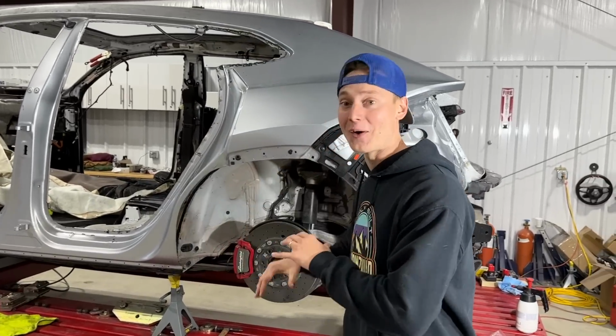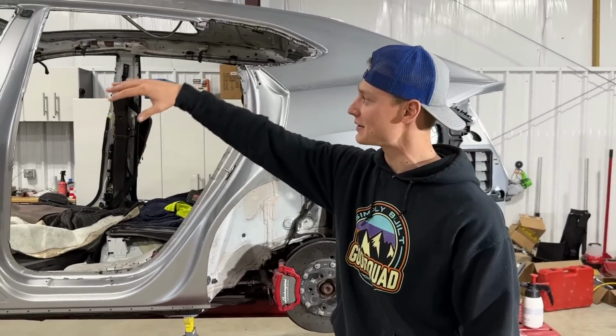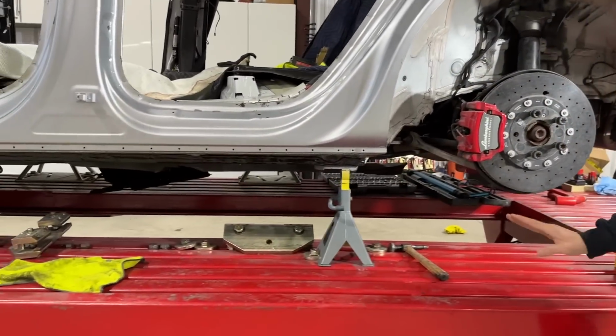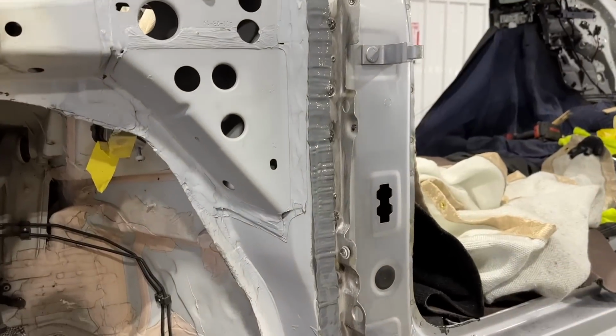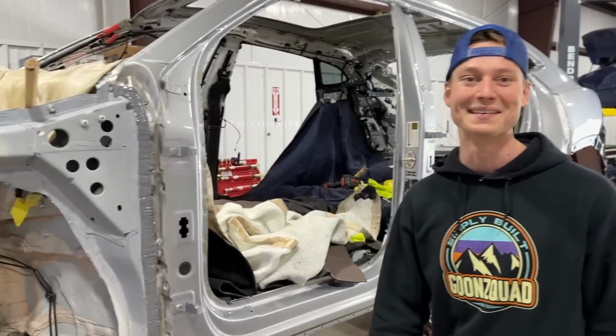Check this out, guys. So we finally got this quarter panel welded on for good. Of course, we threw a bunch of dimes down at the bottom, a bunch of dimes down in that windshield area right there, and we even threw some seam sealer right over the top. And of course, we're gonna throw some paint over that. But look at this seam right here, dude. I don't know how you managed to get it like that, but man, I'm telling you, they're gonna hire you at that factory, and you're gonna get a pay raise every day. Dude, looks OEM right there, dude.